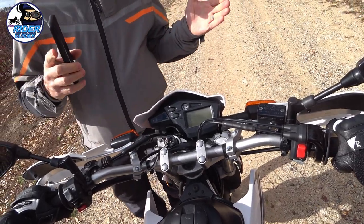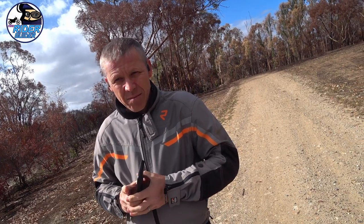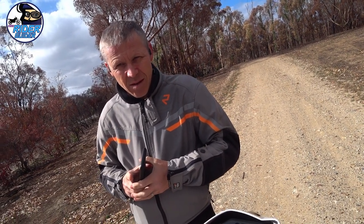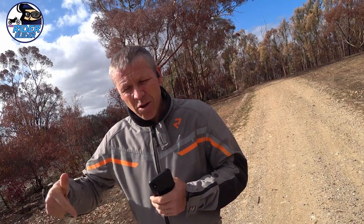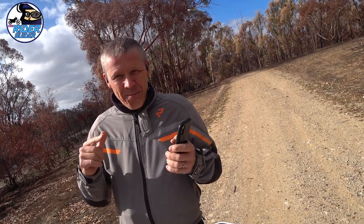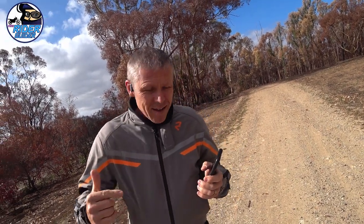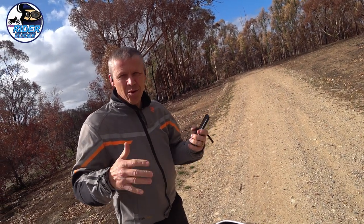Now, of course, it's the same situation. You've got to remember your gears, which were what, do you remember? Well, I'm in neutral now, so down for one, and then up, up, up, up to fifth. And then back down, fourth, third, second, neutral, first. When you're coming to a stop, you can come down the gears nice and steadily, listening, trying to match the revs slowly. But at the moment, I'm really thinking first gear. Well, actually, yeah. No, come on, give me a chance. First gear, and literally, I want you just to go set off and then come to a stop again. That's all we're looking at doing at the moment.